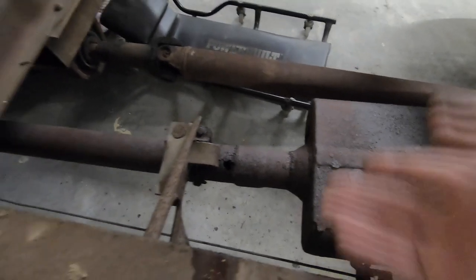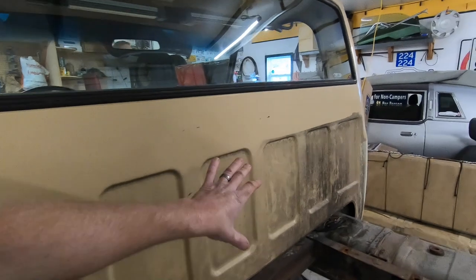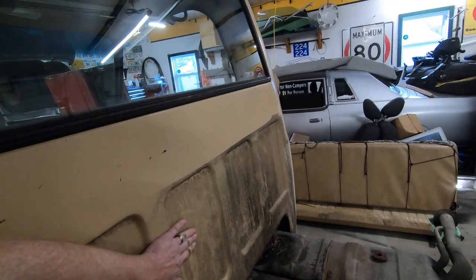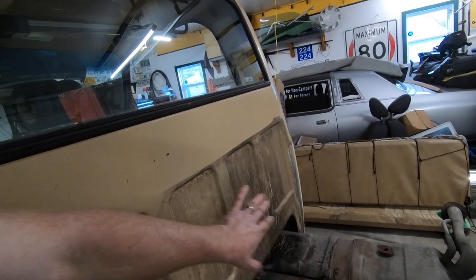From the top side of the exhaust you can see the muffler is likely going to be hacked off — there's a hole right there. Before we put the box back on we'll just cut that off until we can get it back to the shop and put a real exhaust system on it. You can also see where all the tree grime was on this truck — we cleaned it off here but couldn't reach down and behind the box. Having the box off should also give us a lot more clearance and room to work when we go to put that lowering kit on. Without further ado, it's time to start making cuts and get into the real dirty mess of cutting these cab corners and rocker panels off.